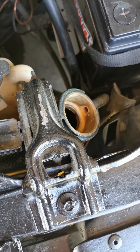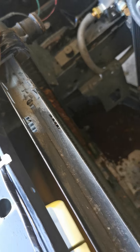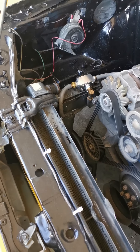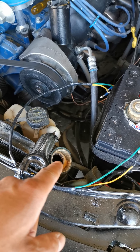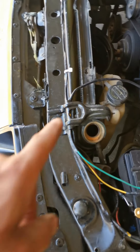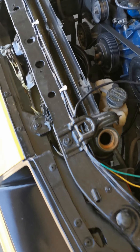So we're gonna do the cheat method one more time - we're gonna try the old rust, lime, and calcium dollar-store CLR. I took my fan off, I'm draining everything, pulling the rad out this time. I'm gonna tape off the lower hose and upper hose connections, throw probably a full bottle - maybe a bottle and a bit - of CLR in, then fill it up with boiling hot water from the kettle and let that sit for a day or two, shaking it up.